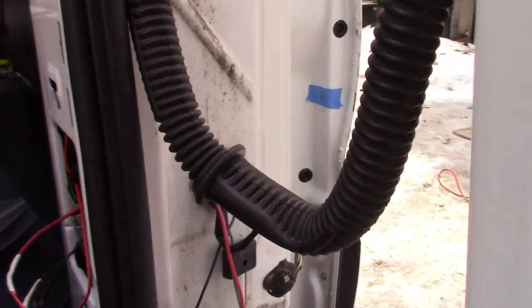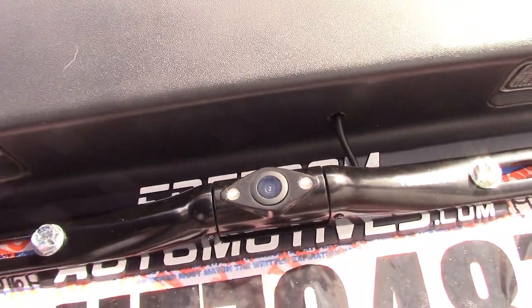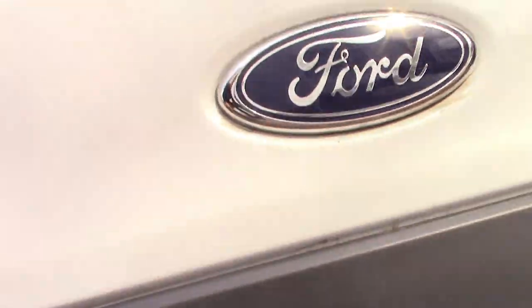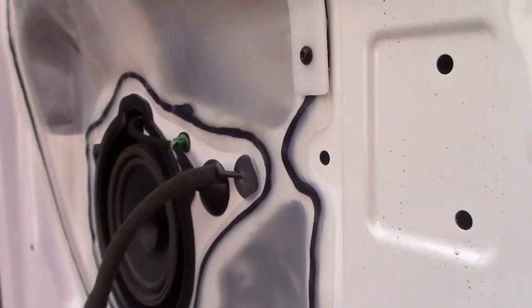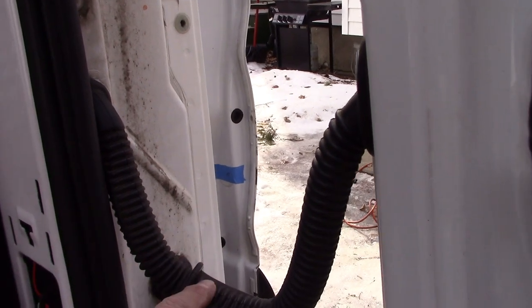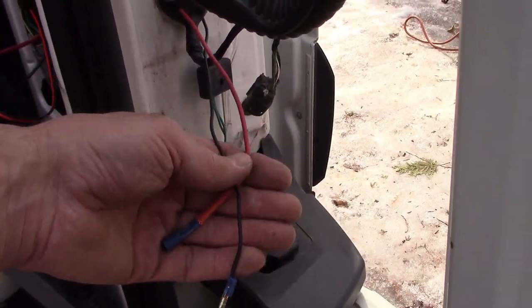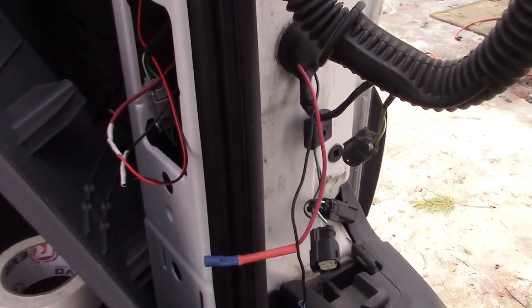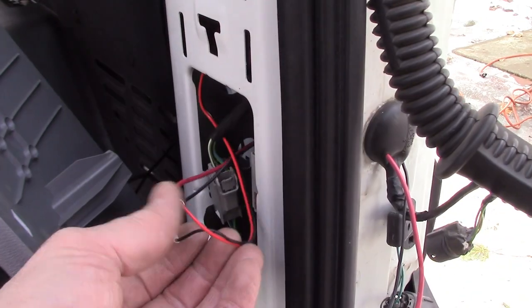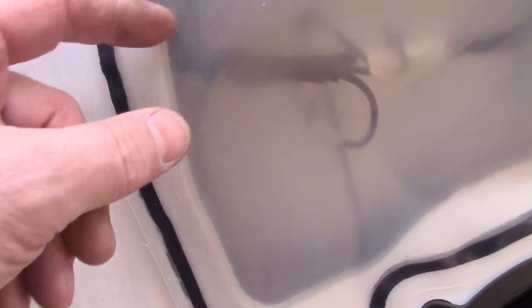At the same time I'm doing a backup camera with LED lights. I had to drill a hole in this plastic trim and went through an existing hole in the door frame. I had to take that trim off, stretched it out straight, and fished the wires through it — it was not an easy task. I'm wiring into the tail light because the camera triggers from the reverse light. When the reverse lights come on, the camera comes on on the mirror that came with it. These power wires come from this pigtail — they're spliced in here but I put it in the door.